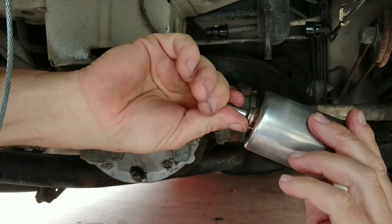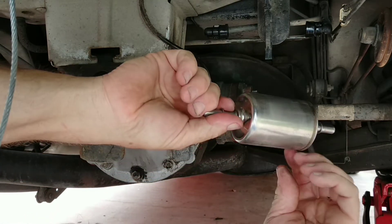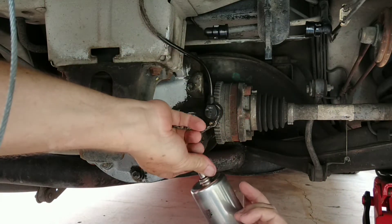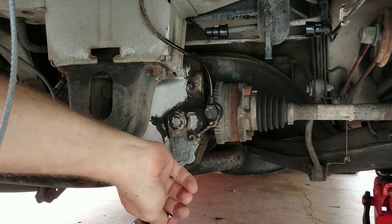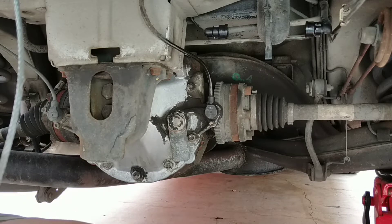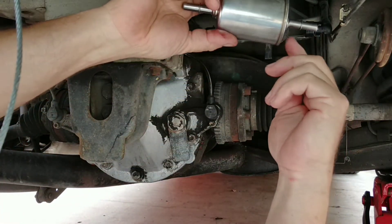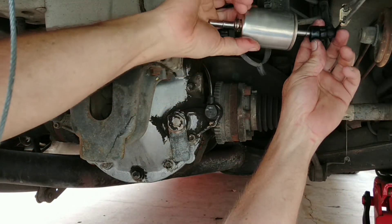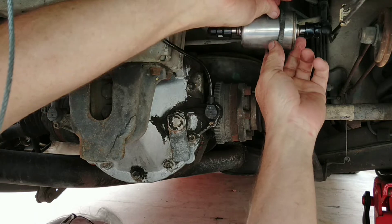Okay, so from the tank, this is the way the old one was set up — with the join at the top facing the tank. There's no flow indicator; this is a super cheap one with no real flow indicator. I'm just going off the old one, which is another aftermarket one, but that's how it's set up. So what I'm going to do is put the top of it towards the outside of the car. Now, that one's clicked in, and that one's clicked in, and then you just do this up.